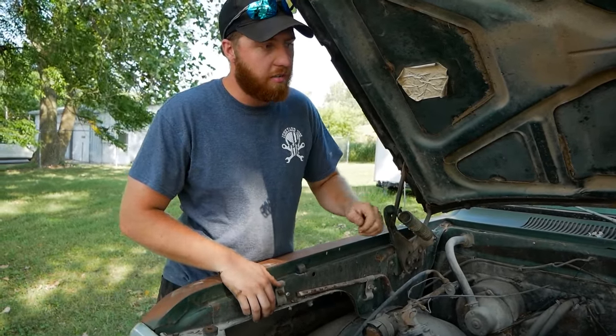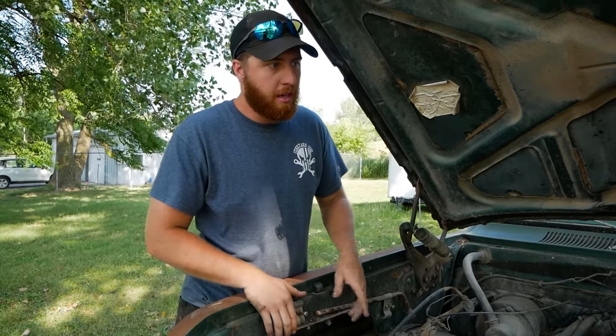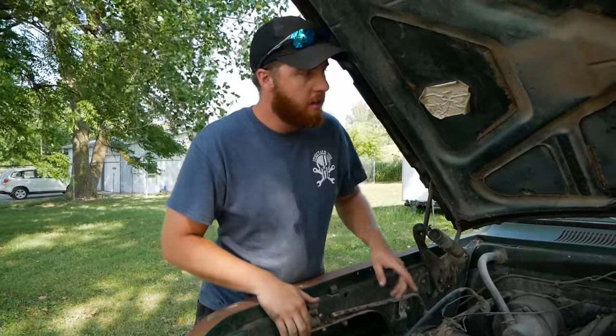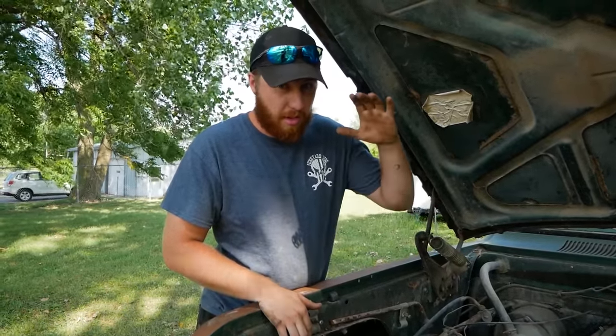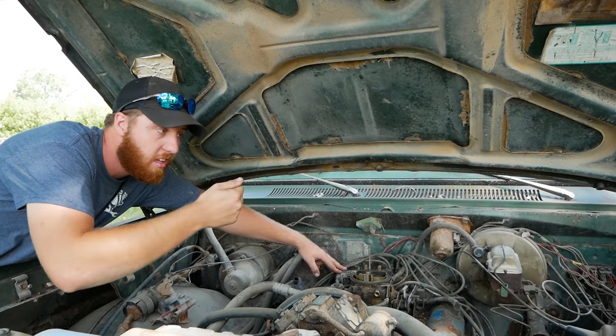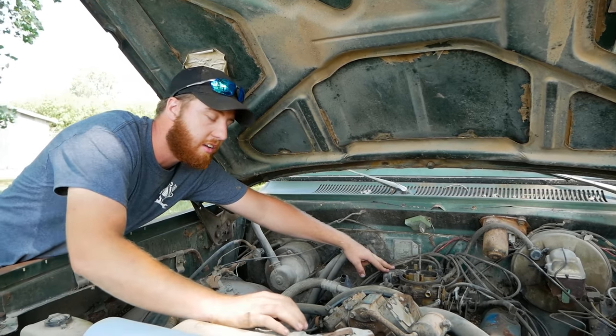Now, as soon as you let off the key, that solenoid opens back up and your ignition is fed through a second source elsewhere from the key through a ballast resistor, which drops it to 9 volts, and then it feeds the coil. What's happening is as soon as Derek or Dylan let off that key, the ignition cuts out and it dies.